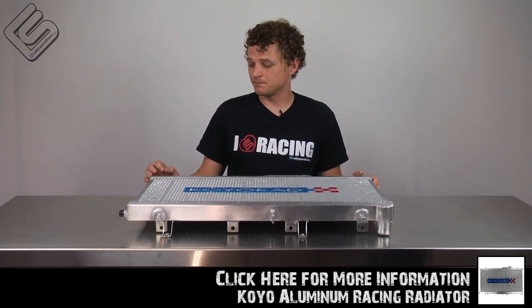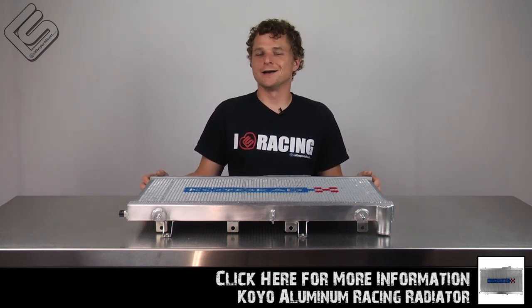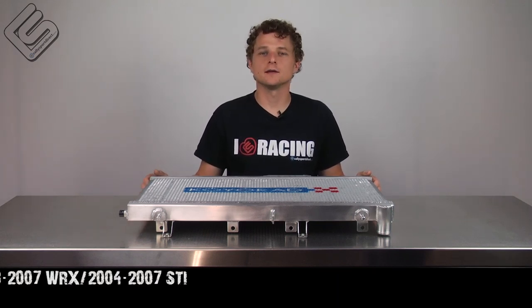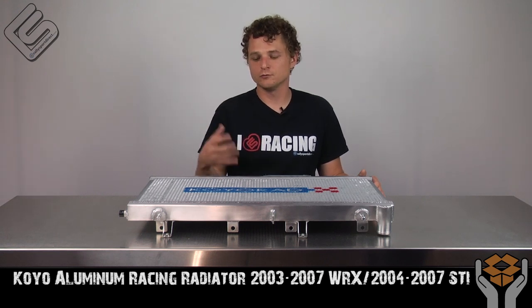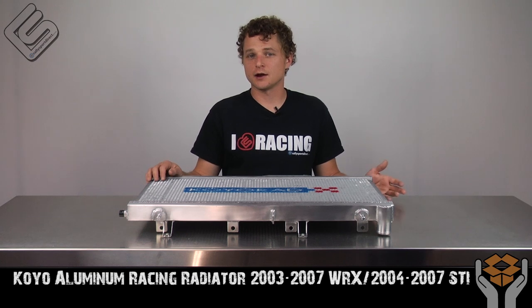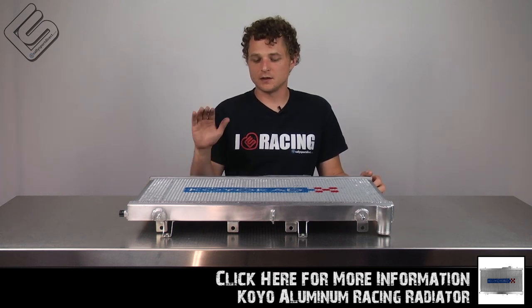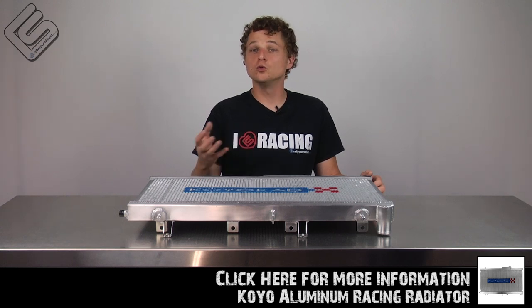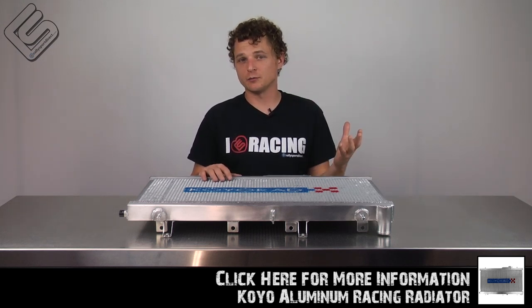Next is better efficiency. The factory radiator is not bad, but if you drive in a hot climate, you like to have fun with your car, and you're a little more aggressive on the car than most people are, going with an aftermarket radiator can be a great idea. One reason is more consistent coolant temperature, which is always a good thing — the ability to run at higher temperatures and more sustained redline without overheating the coolant. Next is the fact that the WRX and STI use a factory water-to-oil oil cooler, so the oil cooler itself operates off of coolant — the coolant cools down the oil inside the engine. Having an upgraded radiator can not only keep the engine coolant lower and at a more stable temp, but can also keep the oil cooler and at a more stable temperature. So you get a double whammy here with an upgraded radiator.